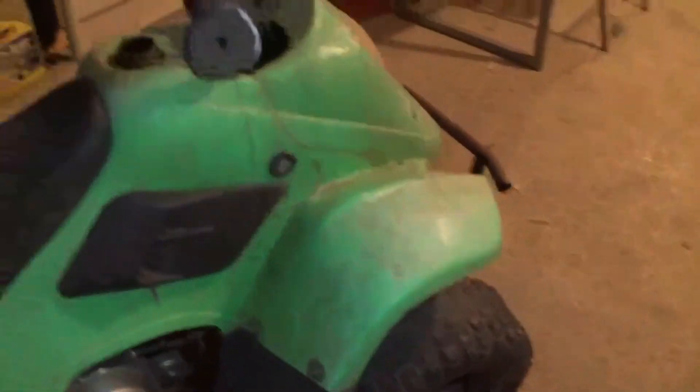There's a bunch of junk on the pedals and stuff. Looks to be an automatic. I had a Honda 70 automatic and that's what the side case looks like. This thing here with the little bolt — when you adjust this, you loosen the outside bolt and turn it clockwise or counterclockwise until the tension gets a little bit hard, then tighten it up. I adjusted mine a few times when I had it. And yeah, for free.